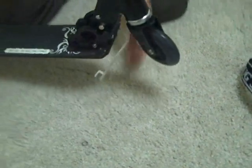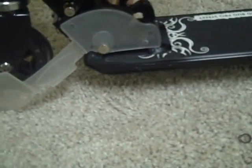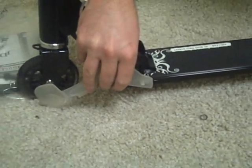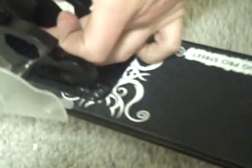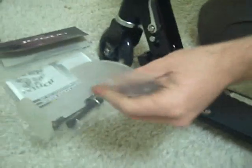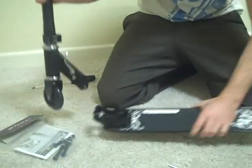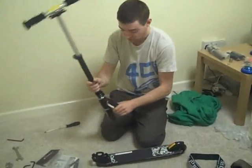Then we come round to the other side and it is attached again to the bolt on this side. Now this bolt needs to come out anyway, so to get that out you might need to tap it through from the other side — give it a little tap. Then undo the little clip like you did on the other side and slide the bolt out. Now in the middle of this there is a spring attached — you can see up inside there. It should just pull off but you might need to get something down to unhook the spring because it hooks into the middle bit. There is a little groove in the middle — you might need to just flick the spring off that. Once that bolt's out, the whole of your JD Bug will fall in half. Don't fret, it's not the end of the world — we will be putting it all back together in a second with our new stronger bolt system.